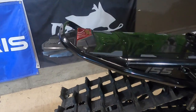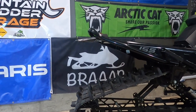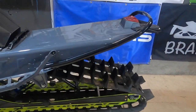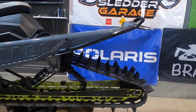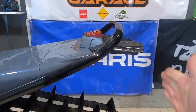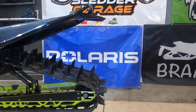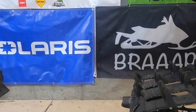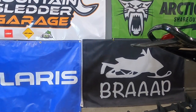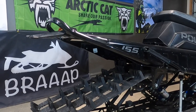Here's our three inch tunnel cut slash — you can get a real good side view here, though it's kind of hard to see with banners in the background. If you come over here to our stock one, this is what stock looks like — that's uncut. The tail here is pretty much even with the back of the lugs on that one. On the cut one, with the back of our lugs here, our snow flap comes in a few inches. So a nice little modification — pretty easy to do in your own garage.